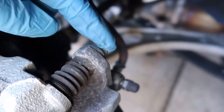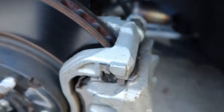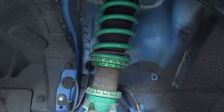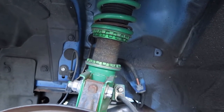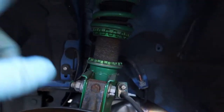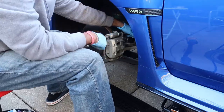Let's get started installing these. First we take the brakes off - there's one bolt here and one bolt here, and that takes the caliper off. Then the bracket itself has one bolt here and one bolt there. That's all it takes to remove it. While I have the car in the air I also want to service and take some measurements - I haven't touched this in over a year, so I want to make sure everything's still even on both sides.